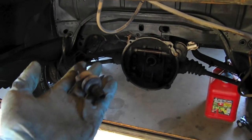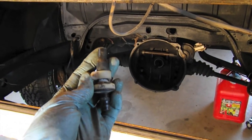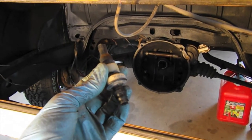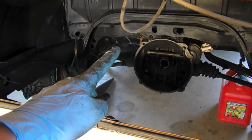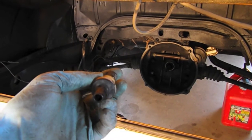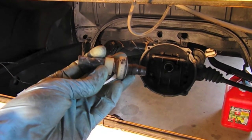Here's the one-way valve for the brake line - the actual vacuum line that goes to the brake booster. I'm going to relocate it to kind of where my finger is pointing, so that it's a nice straight shot directly to the engine. It's really easy to do when the engine's out.